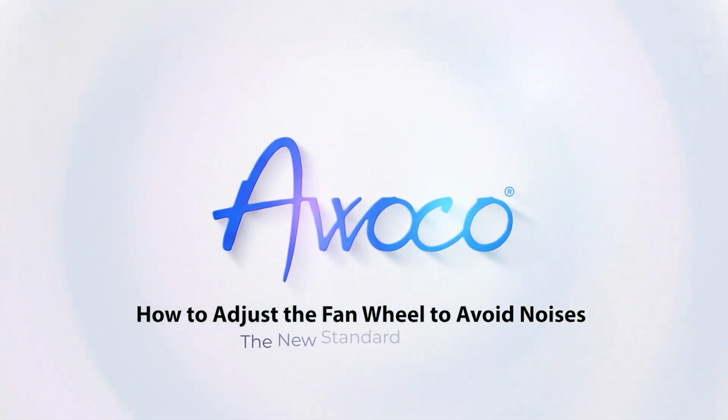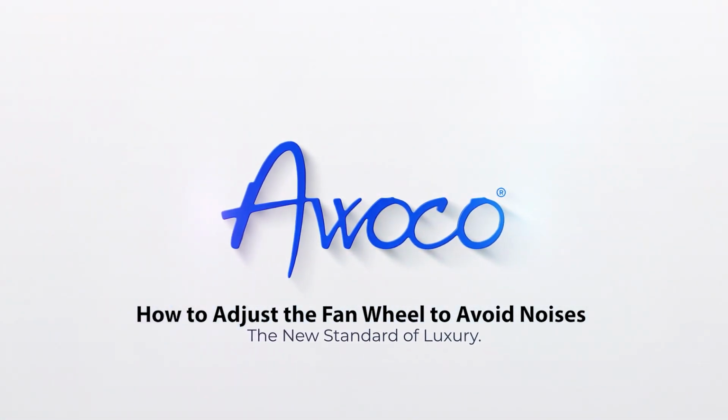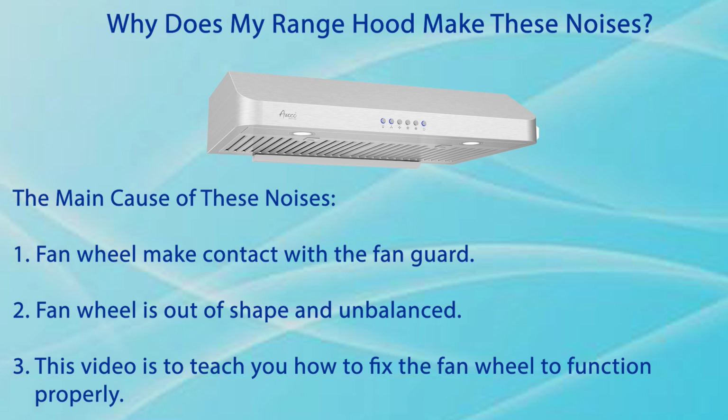How to adjust the fan wheel to avoid noises. Why does my range hood make these noises? The main causes of these noises: 1. The fan wheel makes contact with the fan guard. 2. The fan wheel is out of shape and unbalanced. 3. This video is to teach you how to fix the fan wheel to function properly.